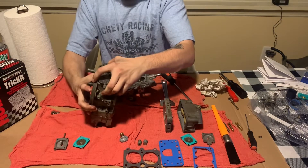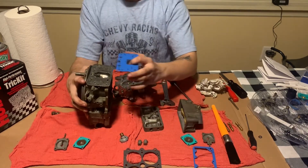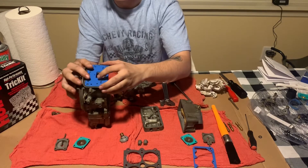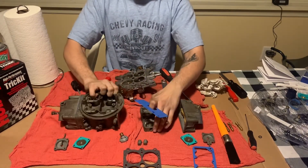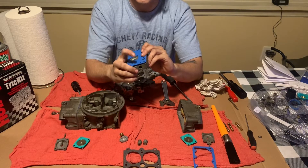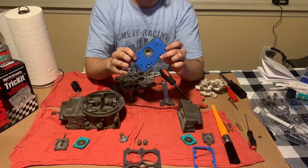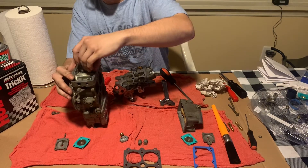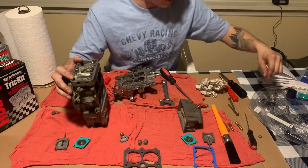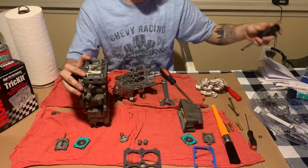That is this side of the carburetor installed with the new gasket. So we'll move on to this side. Now this side does not have a power valve, so we don't have to worry about that. But the same thing applies — you want to make sure that your gasket is going on the right way. This side on the center part of the carburetor does not have any sort of pins, so we want to do our lining up on this portion. Again, if your gasket is on wrong, it's not going to fit and the holes aren't going to line up. What you want to do is flip it over, and as you can see, those two pins are now protruding through, showing that it lines up correctly. Here are the screws that go in there, just like the other side. Hand tight is very close to as tight as these things will go, so you won't have to turn your screwdriver very much.